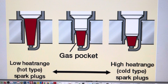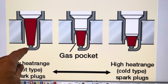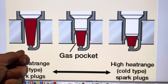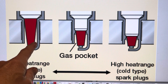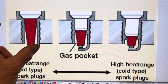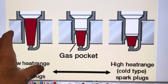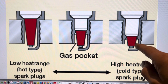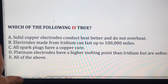If you put a spark plug in that's too hot, this part here can start to glow red hot. Imagine putting a red-hot piece of iron in a cloud of petrol fumes — you could ignite it. The same happens in a combustion chamber: if the tip gets too hot it can pre-ignite the air-fuel mixture, causing the explosion in the cylinder at the wrong time. Pre-ignition can seriously and permanently damage your engine. If you're unsure what plug you should have, err on the side of caution and run a cold type spark plug.